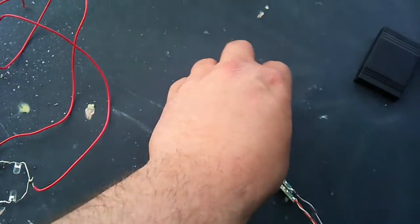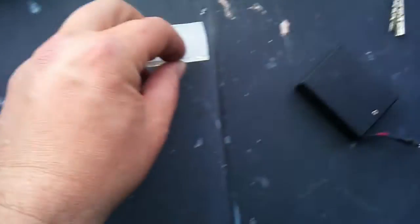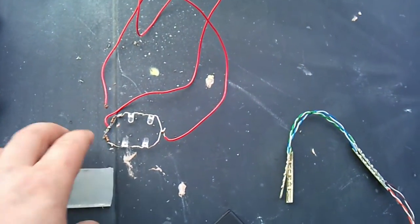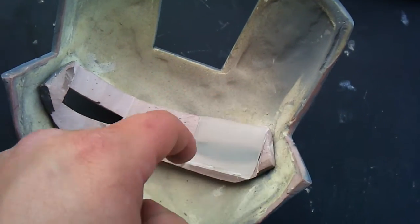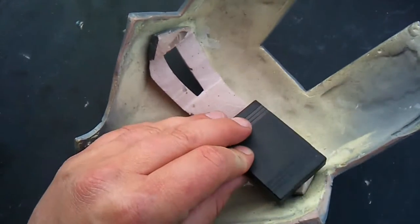These are one of the pieces of plastic that I had for filling in the eye socket here. You can see if it fits inside there — right there. Once you have this and you have your LEDs, the thing you want to do is obviously put the plastic inside the eyes, line the LEDs along the top and the bottom, and then take a black piece of plastic and cover the back of it just like that.